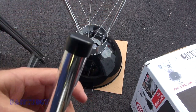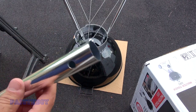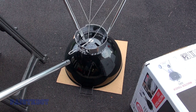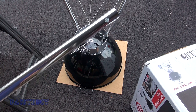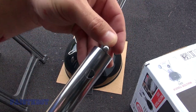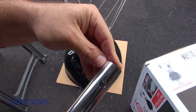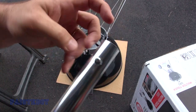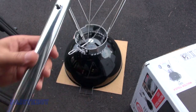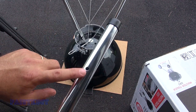This little plastic cap just presses on by hand. Then put the clip that's currently on the leg socket on the kettle onto this leg instead. Feed it in until it snaps in — and don't get it lost inside there. Then feed that hook through this hole.